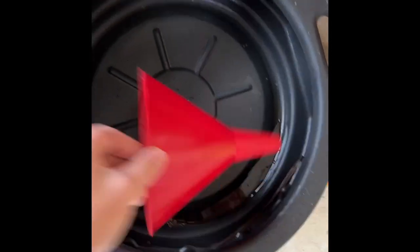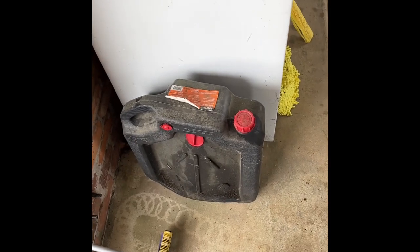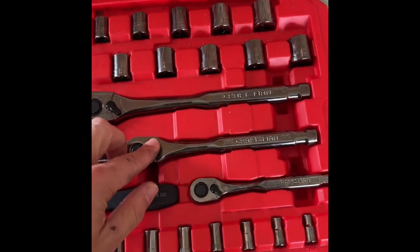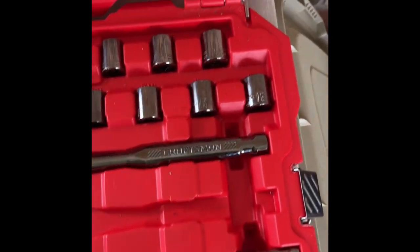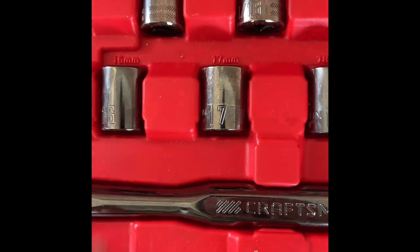This is the drain pan, different from the drain tank — you use the oil tank. I'll make sure that's good and empty. We'll go ahead and slide our drain pan in and get our creeper ready. To remove the oil drain plug we're gonna use our 3/8-inch drive ratchet and our 17-millimeter socket.